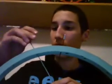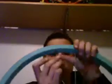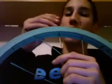Hold on, just let me throw some nipples on real quick so that keeps it all together. Alright, so left of the valve hole. Now the next outbound, the next inbound. Work your way around the rim. Trying to hurry. Alright, so I'm just going to do this real quick, but you pretty much get the gist. Next inbound, next outbound, next set of holes.